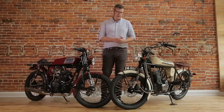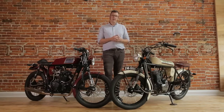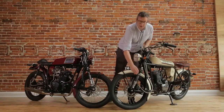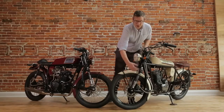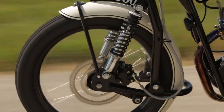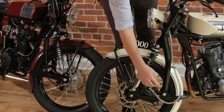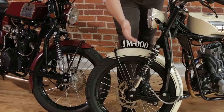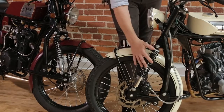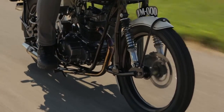The next interesting feature on our bikes is our front suspension. Typically most bikes today feature telescopic forks — a fork that is a single tube which telescopes when it experiences a shock. What we've done, for a number of reasons, is gone to an older design which we feel is actually superior. This is the leading link fork. Just like the rear of the Phoenix, you have a swing arm on the front of the bike pivoting about a central point, and we use traditional twin shock absorbers at the front, meaning you can easily adjust these. We have a couple of reasons for using the leading link type fork.